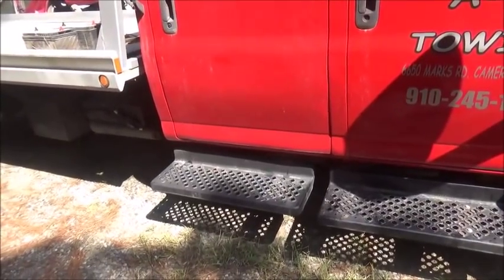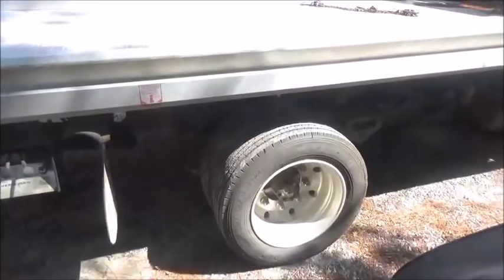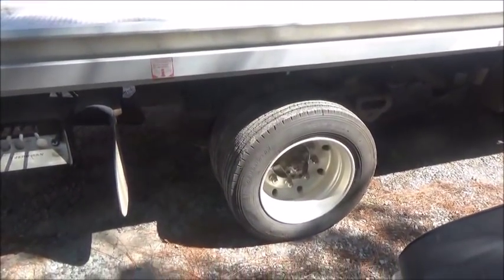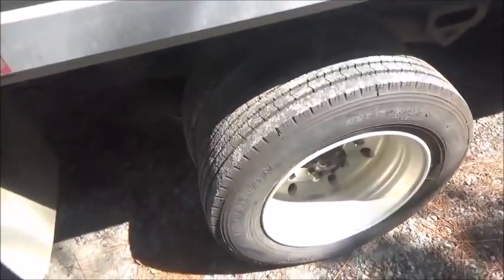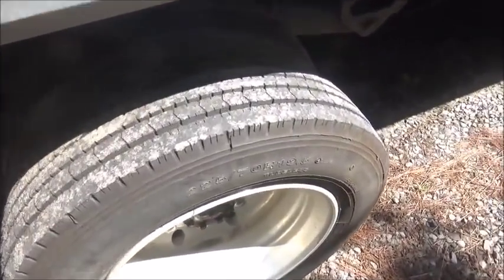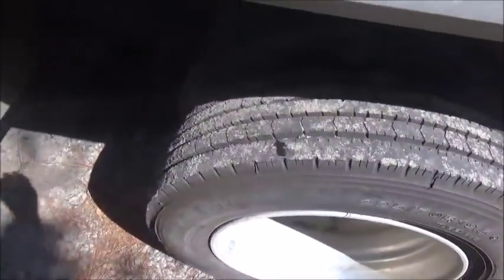I do not like the Link air ride — I'm just disgusted with it. I'm going to do away with the leveling on each side, move it to center, and just have one leveling bar like we do on the Internationals. I've been having a terrible tire bounce. Looking at it now, that valve cap is leaking air — you can hear it. It must be a cap on the inside coming off, so maybe that's causing the bouncing.